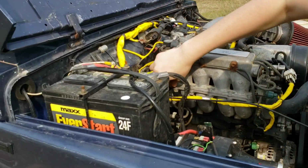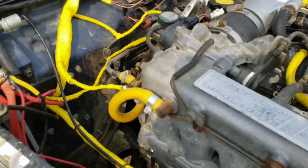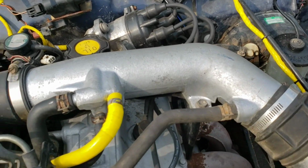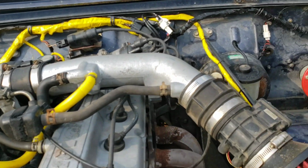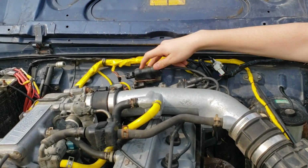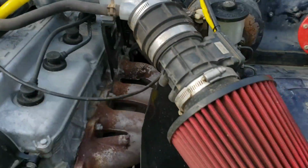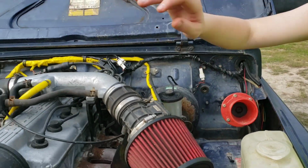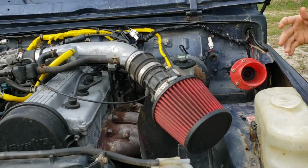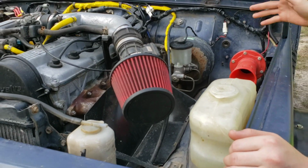So there's a vent line here off this motor that runs around over here to your brake booster, all the way up to here, which confused us. And all we had to do with a magneto for the new motor was just 2 self-tappers in the firewall and just run the cable down here. As you can tell, we have cut up the entire old wiring harness and made it very simplistic and didn't leave any extra wires in it, which just requires you taking apart the entire wiring harness.